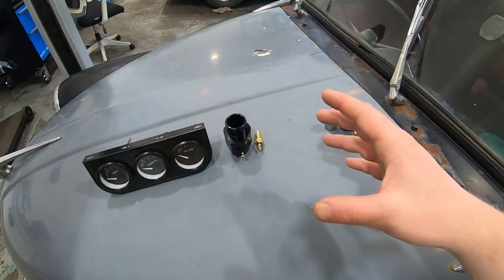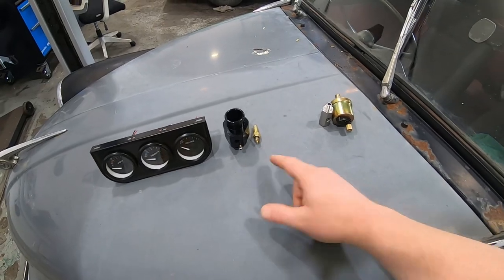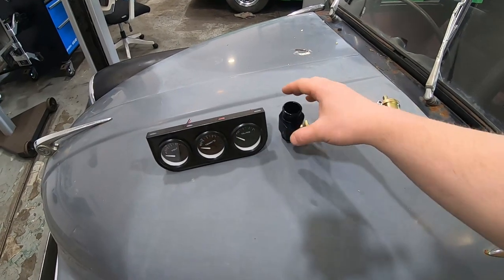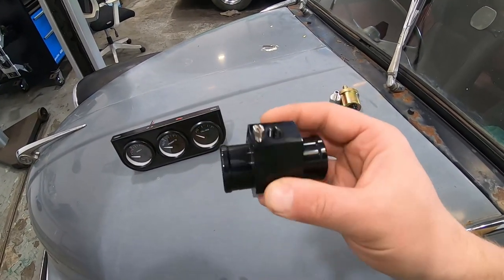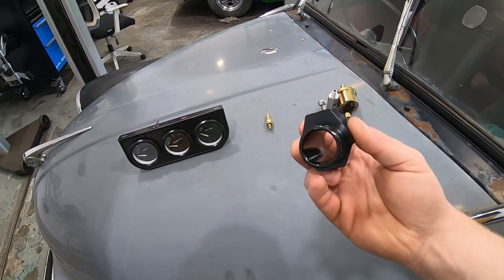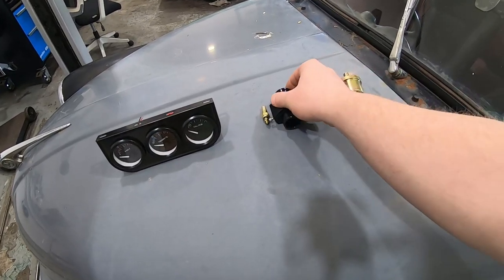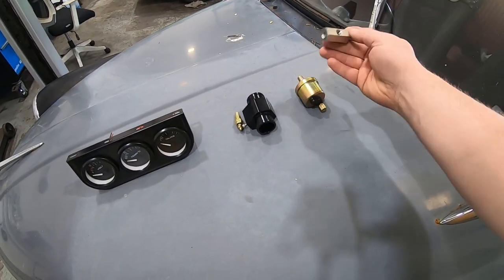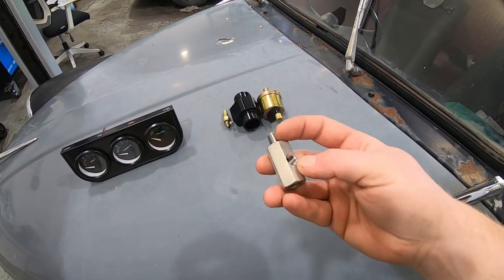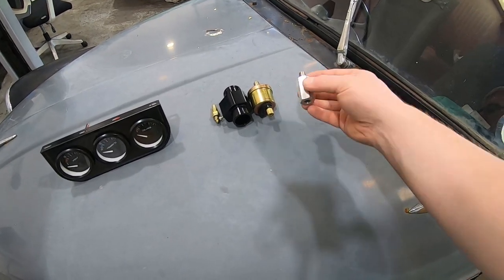Now, things you need - I've had to buy a few bits with this. It came with a temperature sensor and the oil pressure transmitter. What I didn't have is the adapter to go into the coolant hose. I've actually got one of these on the MG Midget, and the coolant temperature switch sits in there, and that then goes in line with one of your coolant hoses. I've also bought this adapter so that we can still have the original oil pressure switch screwed in and have the sender as well.